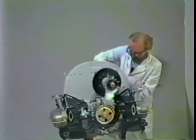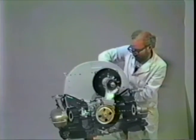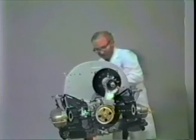Screw all these screws in just not overly tight, just mildly tight, so that you can go back later on when everything is adjusted and screw them down tight. See, the nice thing about powder paint is that it doesn't affect the screw holes too much anymore, because the powder paint really can't get inside a screw, because inside a closed metal object the field is everywhere zero. So there's no charge allowing the particle of paint to get inside, and consequently it can't, ideally.